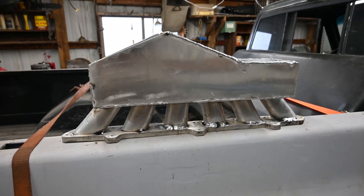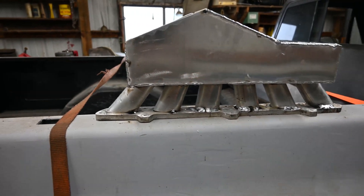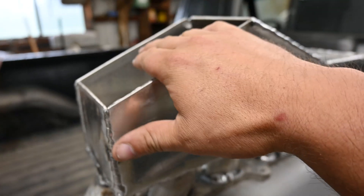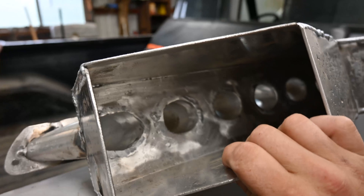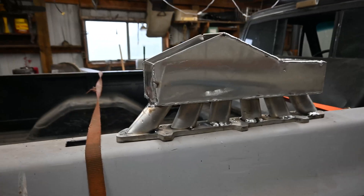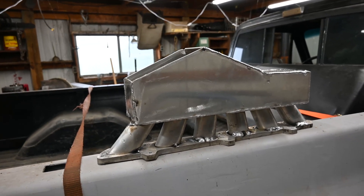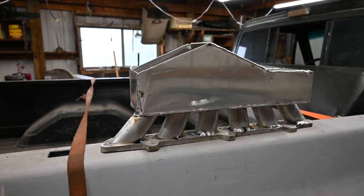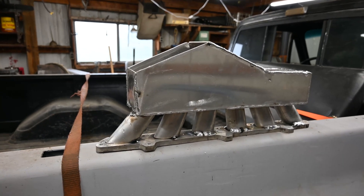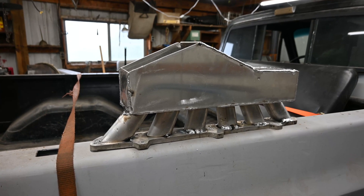I've got the basic shape of this thing down. I've still got some welding to do — that particular welding is time-consuming, you can only do a little bit at a time to avoid warping it. I didn't get the throttle body piece put in because I'm not super happy with my throttle body choice, so I left it off. I'll probably try to find something a little smaller so I can make the plate right from the start. I'm going to put this on and get a good idea of how it fits, then throw the exhaust back on.